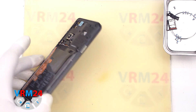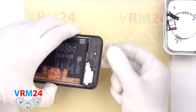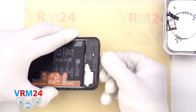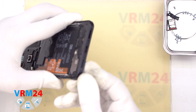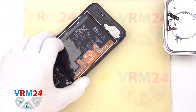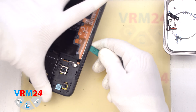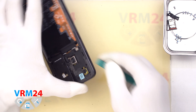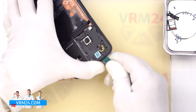After removing the screws, we need to detach the middle cover. We should use a thin plastic film or thin plastic tool, insert it into the gap between the middle cover and the display frame near the card tray hole, and carefully go along the edge to unclip the clips, then use a thicker tool. We need to be careful around the side buttons and the fingerprint sensor, and also around the corners where the cover is held firmly, as well as near the display edge so we don't accidentally break off a piece.